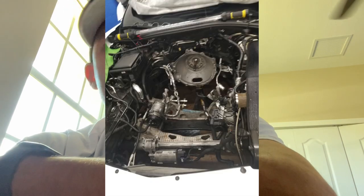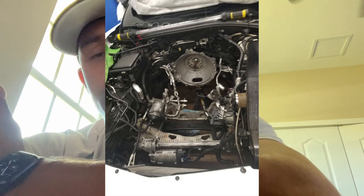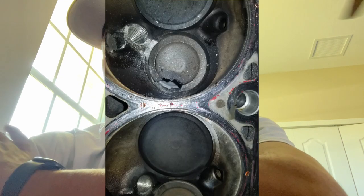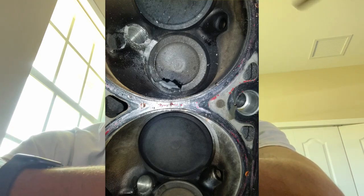Other than that, the rest of the cylinder head looks fine except for the one where the valve seat fell all the way out and got pretty beat up. Moving over, you can see a little bit of damage on the piston and a little bit on the cylinder, but that's okay — the block is perfectly savable. I really thought the oil pump also died, but upon further inspection after taking it apart, everything looks good, no crazy wear, and the lubrication system was still doing its job.